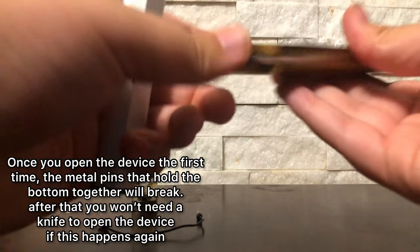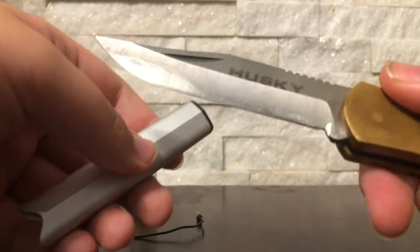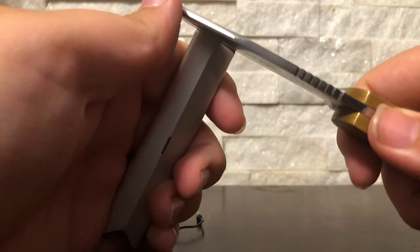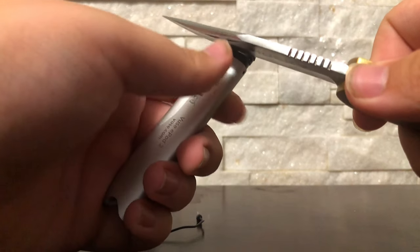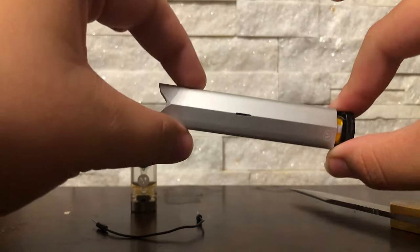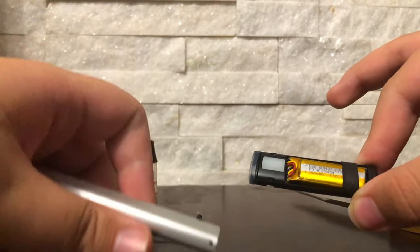On the bottom, take the ridge side of the knife, flip it up, and put your knife between the ridge on the plastic and the metal part of the vape. Stick it in there and then push out and up — it should pop up a little bit on this side. The first few times it will be harder. Then go to the back side and push it up as well, and you should be able to slide it out and carefully pull the whole inside out.